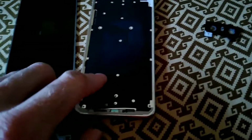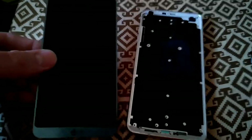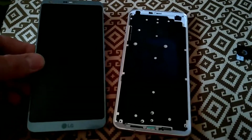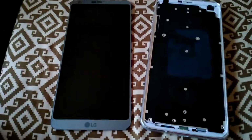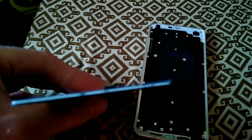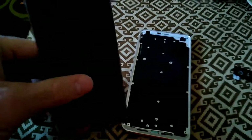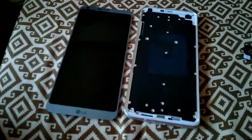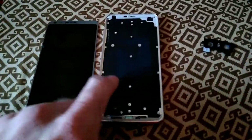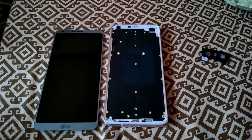I had to disconnect the battery, take the screen out, and I have since reconnected this screen to the phone, and the only thing that I notice it doing is the bottom row of backlights turning on. You can look down through there and see them come on, but the display just remains blank, and I know the phone is booted up. I'm going to connect it in just a second here to show you exactly what it does.